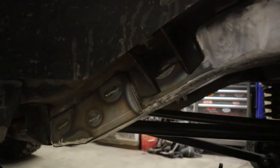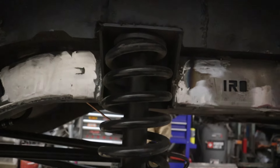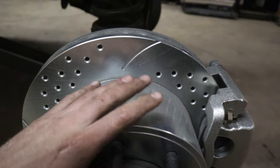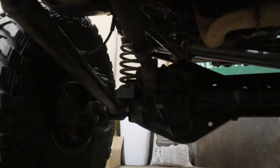The driver's side was a little more clean — the inside of the unibody rail is spotless, so this side welded really nice. Fitment still sucked, but what can you do? We did kind of put the coil buckets in the way, but they would have still sucked without them. We got brakes, coils, four link, brake line ran, and we have a front drive shaft.